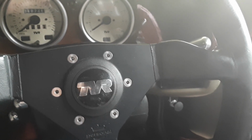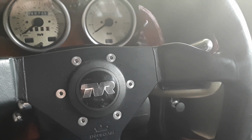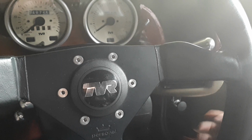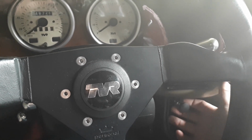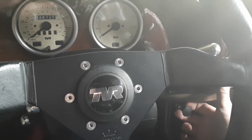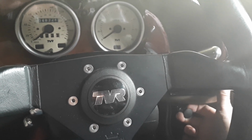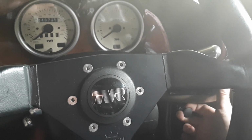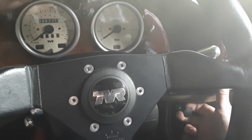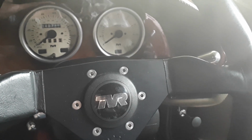So like on your standard Chimaera you have a stepper motor, and on this one you have a Bosch pulse width modulated idle valve. In this case all it is is just an extra air valve. It's actually a heater valve, which obviously, being completely watertight, is also completely airtight. So all it does is just allow sufficient air into the additional air that you need on cold start. So we pull it all the way out. So we'll go for a fully out position.